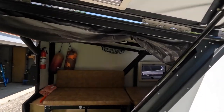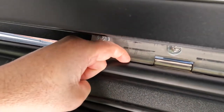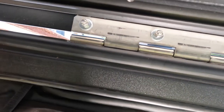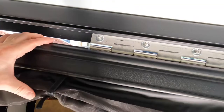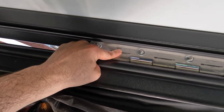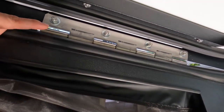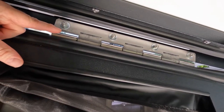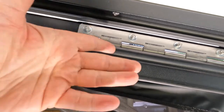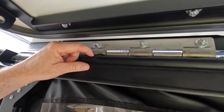After I dried everything up and it started streaming in, I felt up here — I know it's going to be hard to see — but there's no gasket right there. The water is somehow bypassing and getting behind the gasket. I stuck my head up in there and looked really closely. You can see right where this part of the hinge is — this part moves, this part is against the trailer so it doesn't move — and everywhere here the gasket is eaten away. More than likely what happened was each time this door opened and closed, the gasket got sucked under and pulled out repeatedly. The top one is where it became most evident — you can see all three spots where the gasket is just shot.